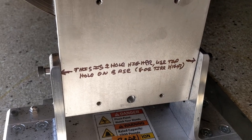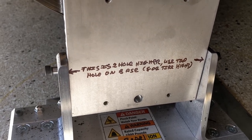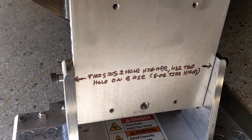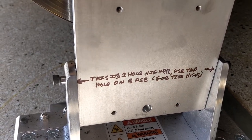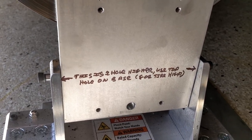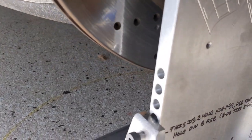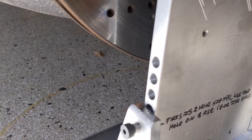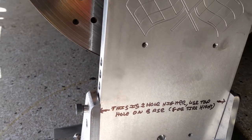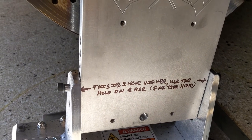Here's a quick note on setting up the hubstands. My rear tires are taller than the front tires, and when you set up the hubstands, they should be the same way — the rear hubstands are taller than the front. In my case, the rear is one hole higher: three full holes and a half in the rear, two full holes and a half in the front. This is in the instructions; check it for your car.